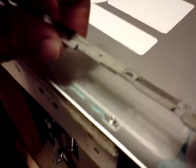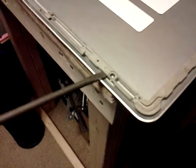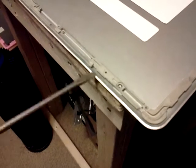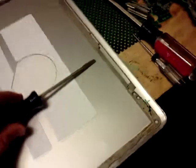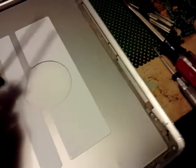I started down here at the front — you can see there's a little notch right under there where you can fit a screwdriver and apply force using the edge as a leverage point. You need to be very careful not to bend the outer ledge as you're pulling this off. Go very slow as you work your way around; there are some very thin spots down here and up top as well, and those are glued on.